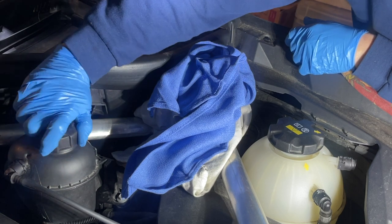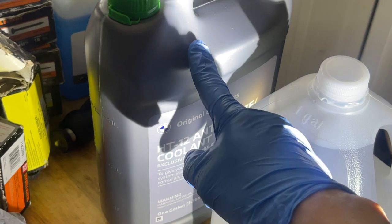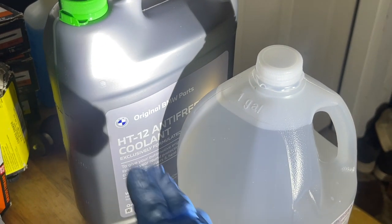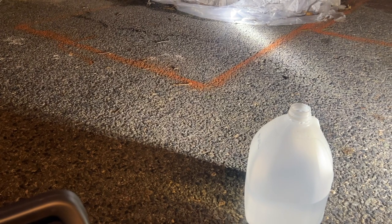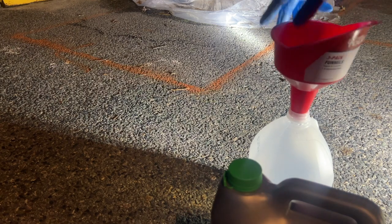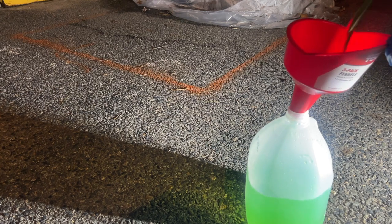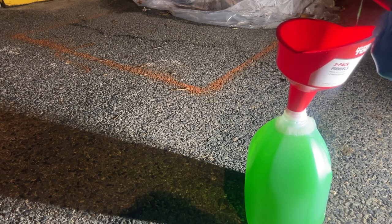The best way to do this: I'm going to pour half of the coolant out and save it for later if I need to mix more. It's about 25 to 35 bucks for a gallon. I'll pour half into here to get a 50/50 mixture. Pour half out, then put half in — and it is green, confirming it's the right HT12. I'll take another amount out to save; that way I don't have to go back to the dealer.